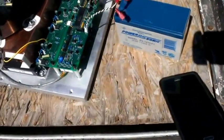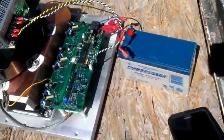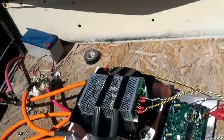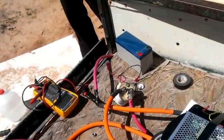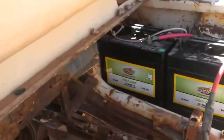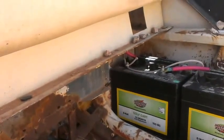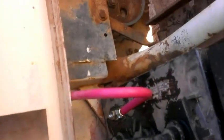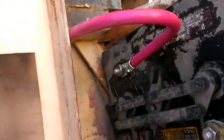We have connections ready for our 12 volts right here. In here, we have four 6-volt lead-acid cells. So the one over there with a red cable, because that's all we've got, is the most negative of the pack. And then you go positive to negative, positive to negative, and then on this side you can just barely see the positive coming here, which comes up through the hole here. So that looks right.